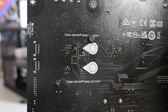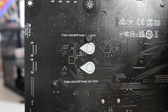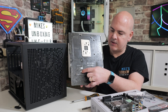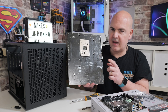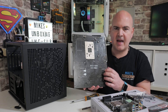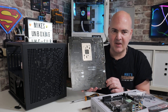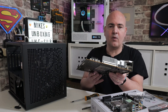This is actually where pillars potentially could be. And on the back of this ATX board, this gives you a really good illustration of how micro ATX is actually laid out. Micro ATX, being slightly smaller, actually has mounting pins or pillars in either of those two locations, and one on the side possibly. This is also quite common if you've got an ASRock or an NZXT motherboard — they sometimes have 10 mounting pillars, giving you an extra one in between the middle and the bottom ones that you have on traditional ATX.